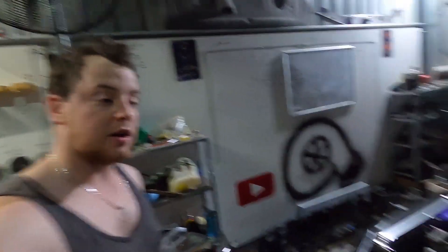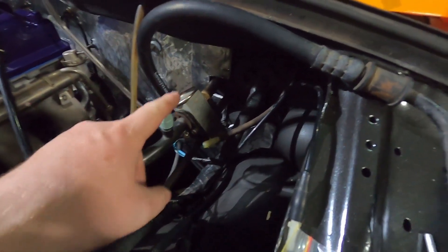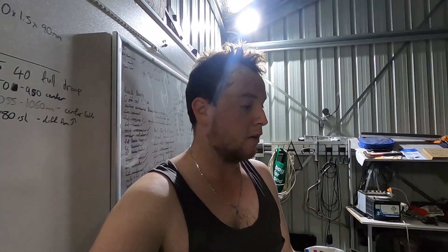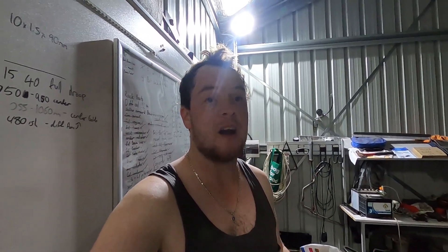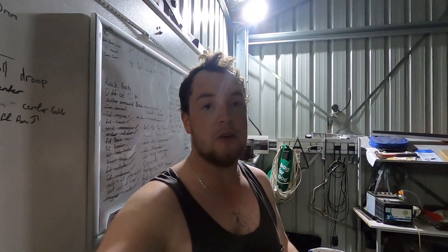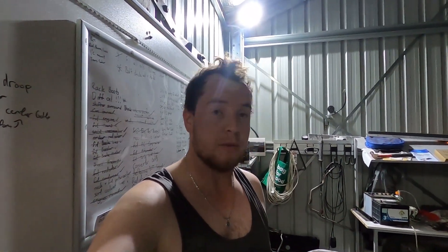What an absolute mission — it's about 30 degrees. The hoses are in. You've got your TX valve and then a custom line which runs through into the compressor. The aircon line is done — and the guys at Hose Mart in Wangara did a really good job, reasonably priced too. A lot of people scrap the aircon in conversions, but it's honestly not hard to get lines made up. With a bit of ECU trickery and a solution from Canberra, the aircon will work.